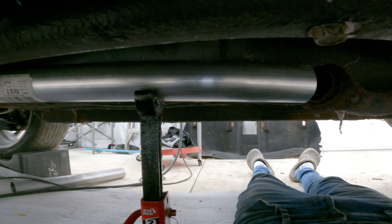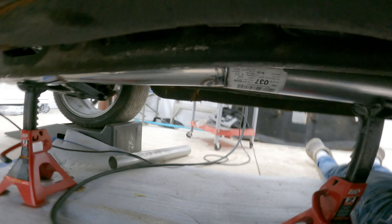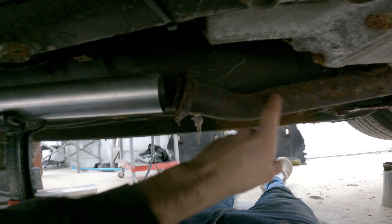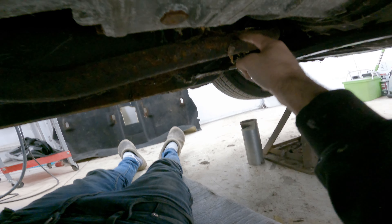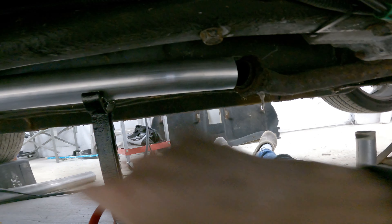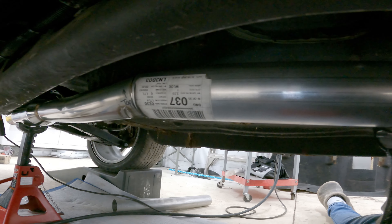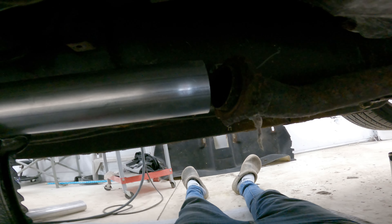Okay, so I've got this piece cut to fit. This is super janky and not great, obviously, but I got it somewhat flat looking. There's a giant kink in this pipe back here, which puts it like way towards the drive shaft for some reason. So ideally you'd cut it way back and then put like a straight piece in. This gradually comes down, so you could actually weld the flange on the car and just go straight from here all the way in. But I don't have enough pipe for that, so this will work. I'm going to tack this here and then trim this end and this little flange so we can hook this thing up and hopefully start it.